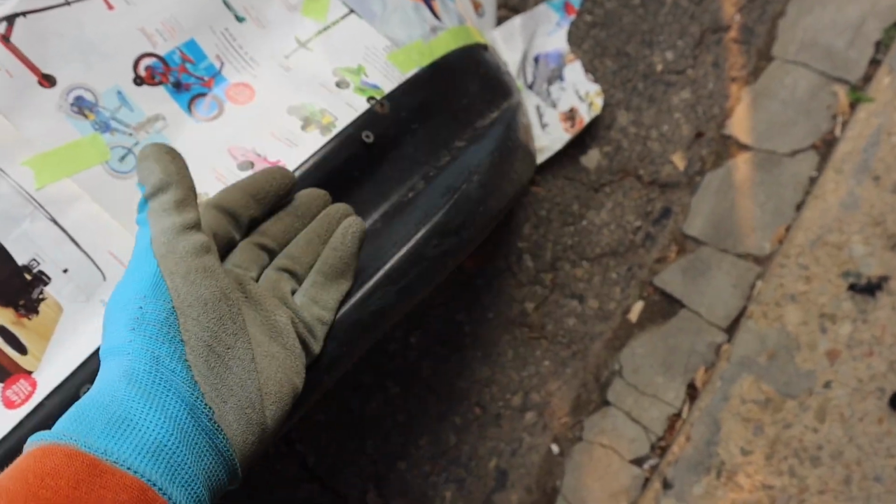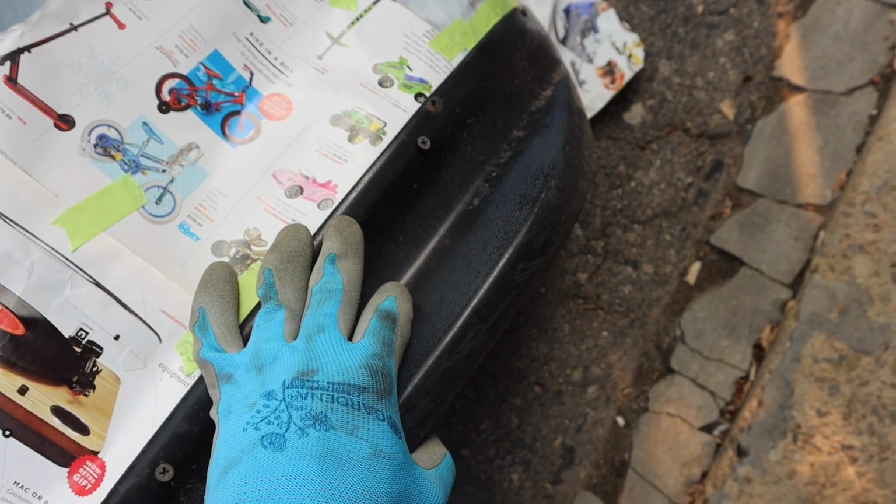Okay, so masked up pretty much most of the lip. I know, guys, I could just take it off and paint it, but this is an annoying lip to put on, so I am not taking it off. Since the front lip of the Speed 3 isn't really scuffed up or badly damaged or anything like that, it just needs to be cleaned up a little bit. I'm gonna go ahead and use 400 grit sandpaper, and then I'm gonna finish with 1500 grit sandpaper, and that's when we'll just apply the paint or the primer. But I don't think it really needs primer, so I'm just gonna put on paint. It's gonna get scuffed up and scraped anyway, that's the whole point of a lip. So we're gonna use the 400 first, then continue with the 1500, and then apply the paint. So let's get to sanding now.